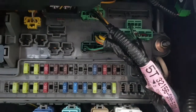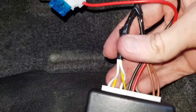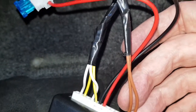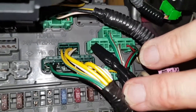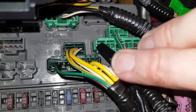Here's the module all wired in — a quick recap. The main control wires come from the door switch connector, feeding into the white and yellow wires. The yellows are the common ground, the white wire is for locking, and the white with black is for unlocking. The brown wires are for the indicators — left and right. Looking at the wiring diagrams, there's a connector up here with green and red, and green and yellow wires, which normally go to the back indicator lights but are wired to all of them. I've already tested that and it works.